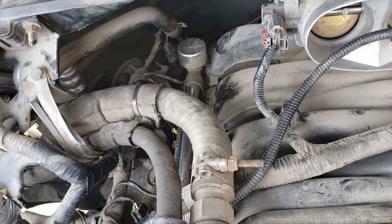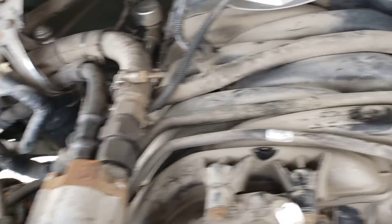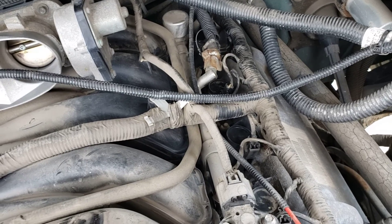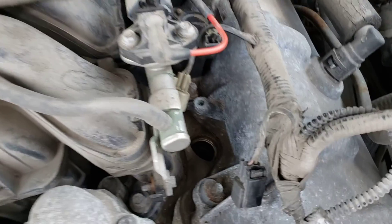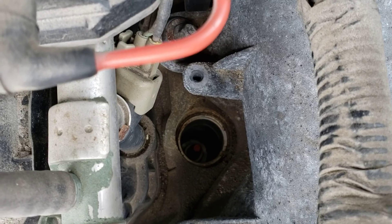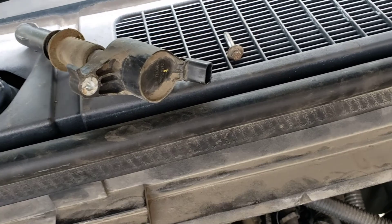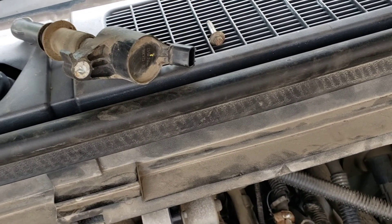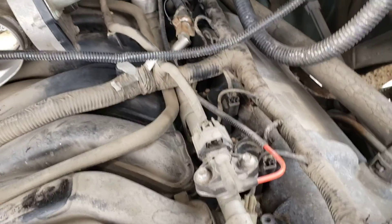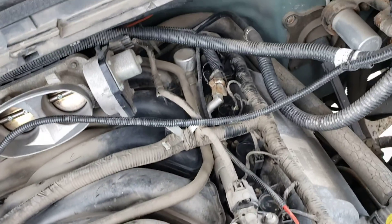So I replaced four and five over here and got those ready to go. I did have an issue with cylinder nine, so I don't have a new part — I'm going to take cylinder nine and swap it over to cylinder one until I can get a new part. This is where the spark plug goes down in that hole, the coil pack goes on top of that, there's a seven millimeter bolt that holds it in, and then there's an electrical connection that goes on there. Overall, once you get the air filter off, it's easy to get to any of those coil packs.